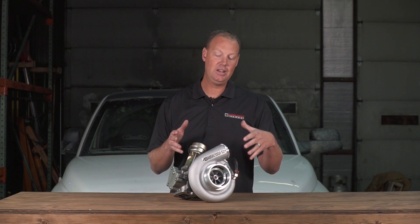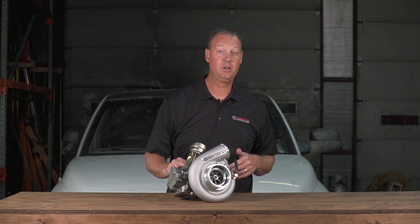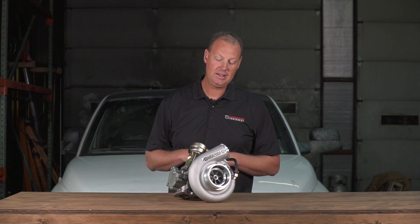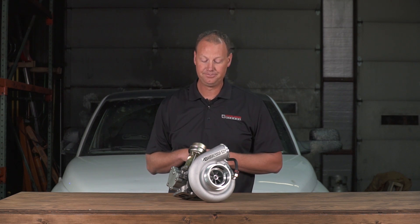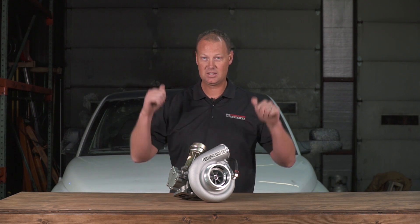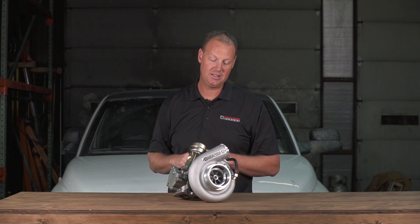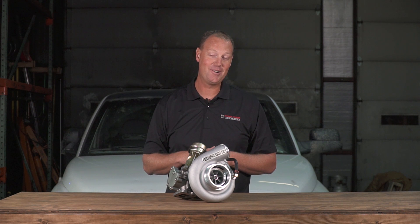This is not a brand-new turbo in that it's a 62mm paired with a 65mm turbine wheel — that's been done for a long time. But this one comes with an SXE-style cover and it's very affordable. We're excited to see how this thing does here, and we're actually going to put this on Meijer's little hooligan truck behind us. This is a little short bed, 12-valve. It's pretty rowdy.